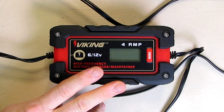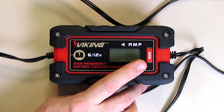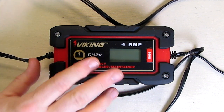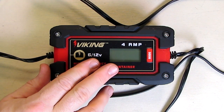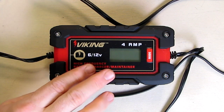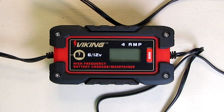The display is unique — it shows charge of battery, battery voltage, and tells you whether you're doing AGM batteries or winter mode. We set it for winter mode for the batteries. You also get polarity reversal indication. The actual modes are: standard charge, AGM charge, standard with snowflake mode, or AGM with snowflake, which is for wintertime — because you want a different maintaining profile in winter than in warmer weather.